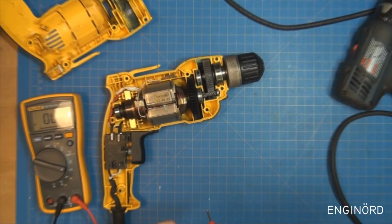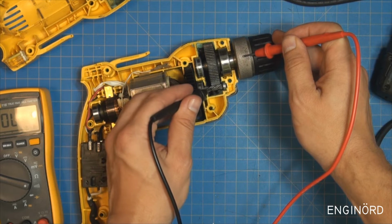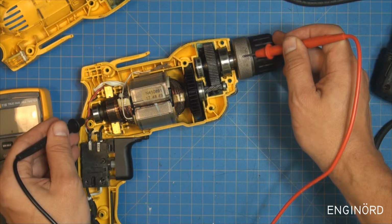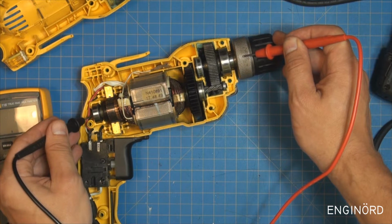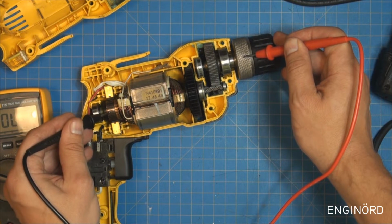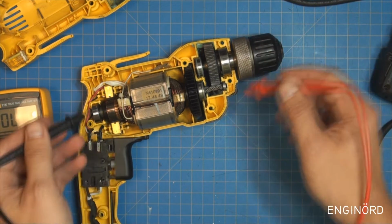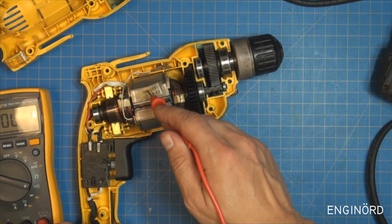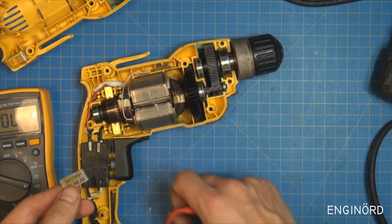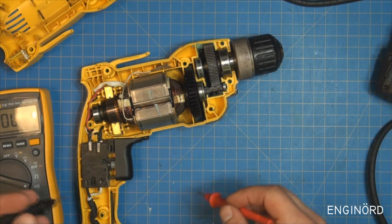Yeah, let me bring it closer. Okay, so this connects to the large gear, which connects to the small gear, which is connecting to the armature shaft. Okay, so this is the armature shaft, this is the armature bearing, here's the commutator. Okay, and then this is the lamination. So even if one of these wires is touching the lamination, that's not supposed to be a problem.